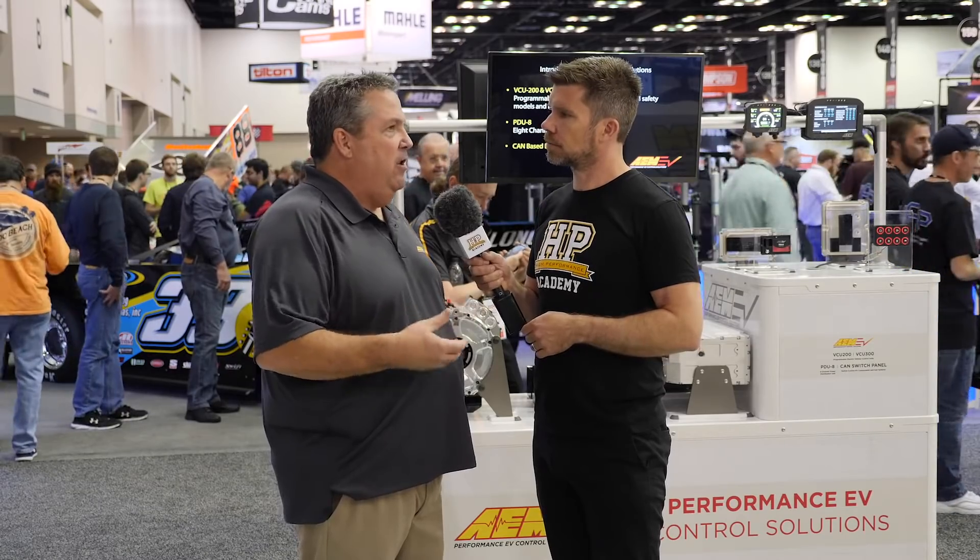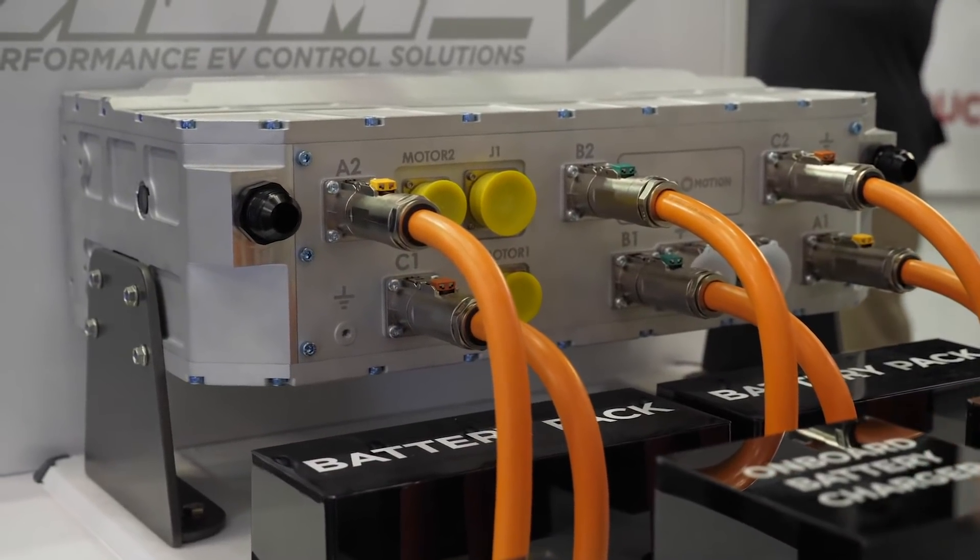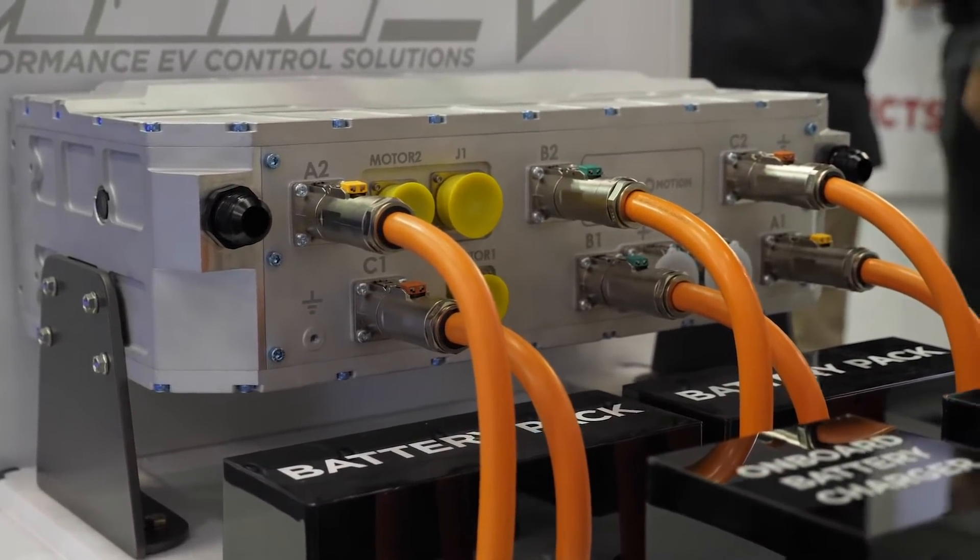Firstly, the big battery in the car is DC — direct current. The high-performance motors available now are AC, or alternating current — usually three phases. So you need to convert DC to alternating current, and it can't just be any alternating current; it has to be very critically timed with the rotational position of the motor. A device called an inverter is used for this, and it's very closely tied to the motor itself — they really work as a package, almost symbiotic.